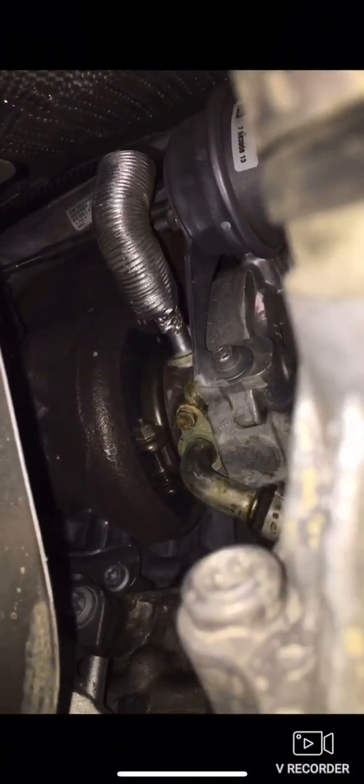Front suspension looks okay. Front brake pads are in good condition, measuring at 12mm, both fronts. Front tires are measuring at 6mm in the center, but on the outer edges we are measuring at 2mm. As you can see here, we hardly have any tire tread on it, so I'll be recommending both front tires with a 4-wheel alignment to prevent the new tires from wearing out unevenly. And we also set tire pressure to 36 psi on the front and 41 psi at the rear.